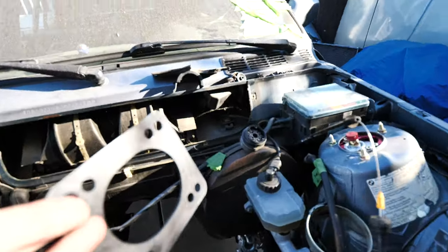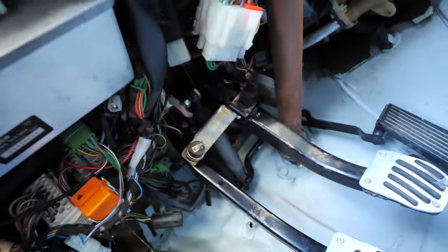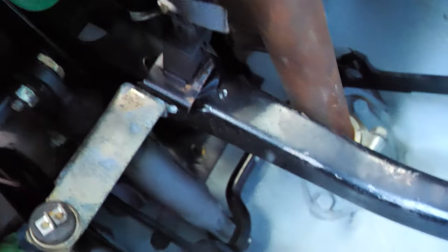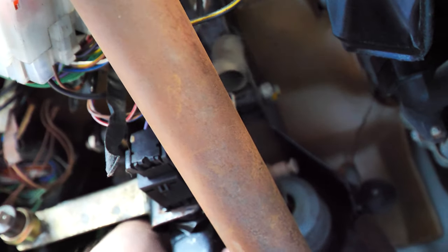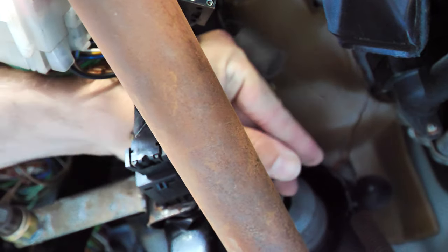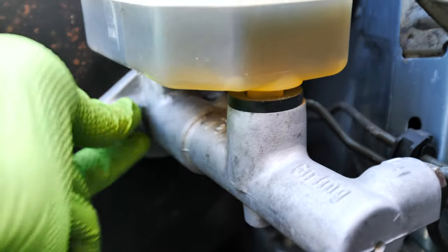Let's get back to it. To unbolt the master cylinder, we've got two bolts here and then underneath in the pedal area there are about four bolts. We'll have to take those off - they're all around the brake area because this goes right through to the little clevis right here. So we're going to undo those bolts and re-drill that spot. Sometimes you have to weld on a little extra piece to connect it back. There's a little spring that goes on that little pin and a retainment piece that keeps it all together, then we pull that little pin out.